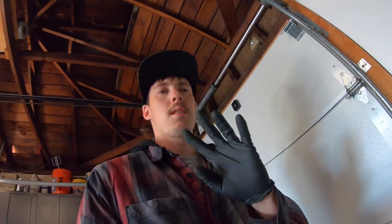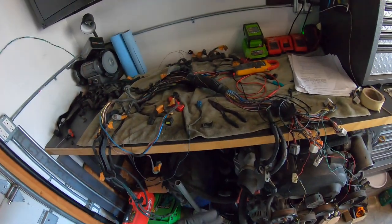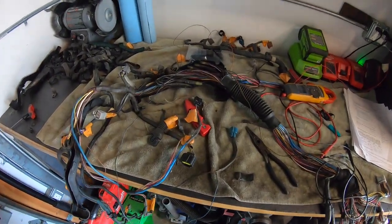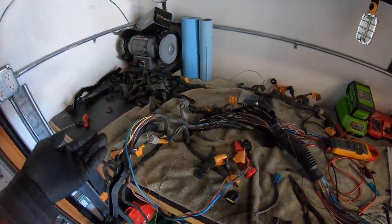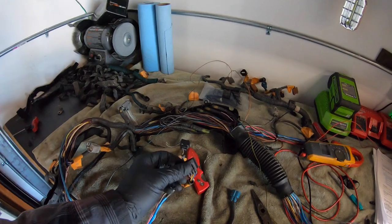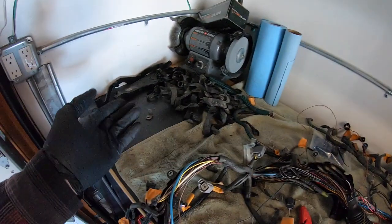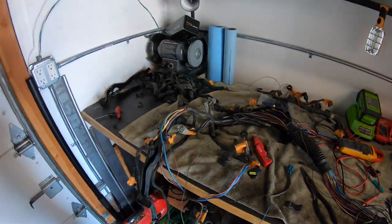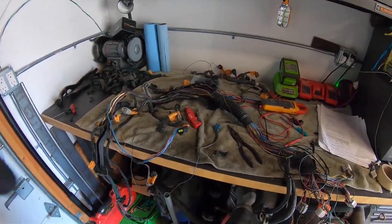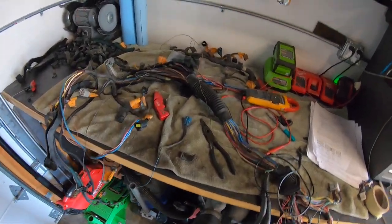This is actually a really long process, but not very stressful as long as you keep track of what you're doing. You see different things on the harness that come out at different points — you don't want to get that all messed up. Before you tape it back up, it's always best to put a zip tie right here so you know this plug needs to be right here. Make sure all the plugs plug in, then adjust your zip ties and tape it when you're done. Doing this will save you $1,000 on a wiring specialist harness — and for about $120 in new plugs and wiring loom, you can make this OEM harness look and work like an aftermarket harness.